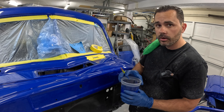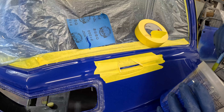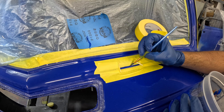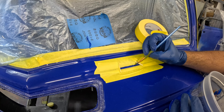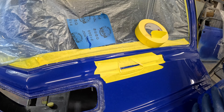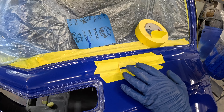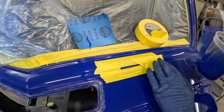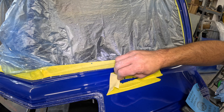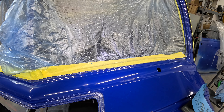I'm going to do a couple coats, wait flash times, all of that — just to see if I can get it to be exactly the same color. I'm on the GoPro so I don't have a fancy camera but I'll get you as close as I can. I'm just going to dab it in. I might as well do the little one too so it all blends. I'll leave that for a bit and come do two or three coats. I'm not going to go exactly flush — with a paint pen that's what you would do, but I'm going to get close and fill it with clear like we've been doing with the indentations. There it is — three to four coats on it, super thin stuff. It finally looks the same color again.